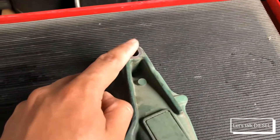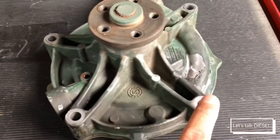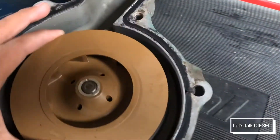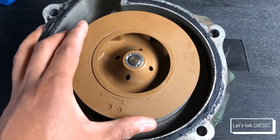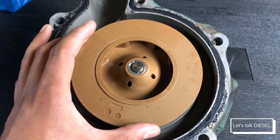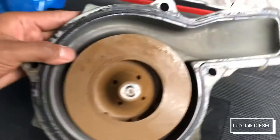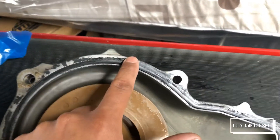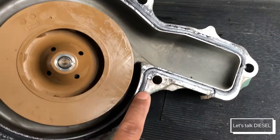If you see a stain around there, you have to replace the water pump. You have the bolts — one, two, three, four, five, and six. I think those are 12mm bolts, or 10mm sometimes. On the back it's quite interesting because Volvo uses a plastic propeller in there. I've never seen that break or anything like that, but maybe that's why it's bigger than the others, because that's a really big propeller compared to the ones in Detroit applications.